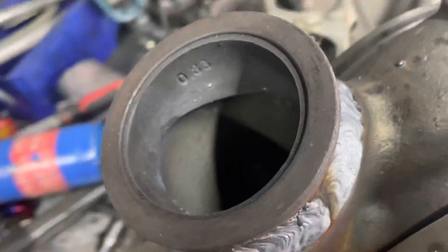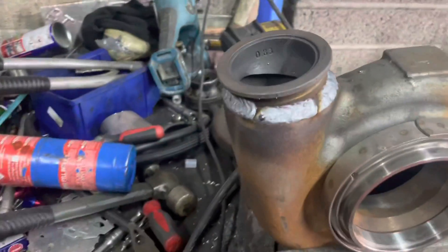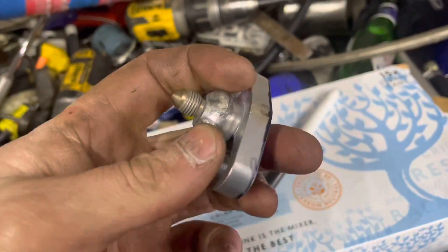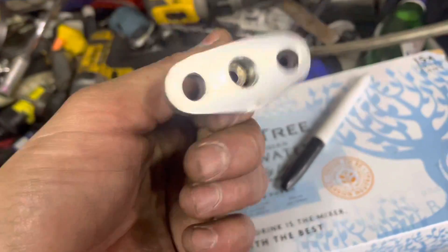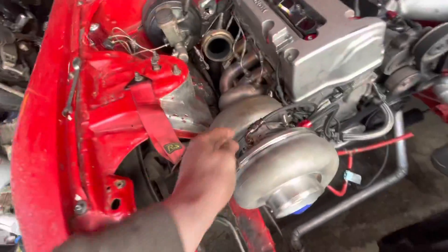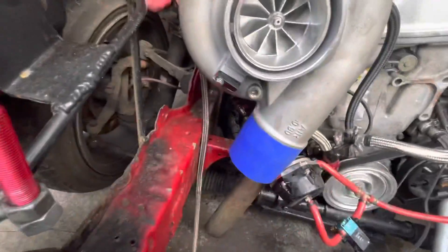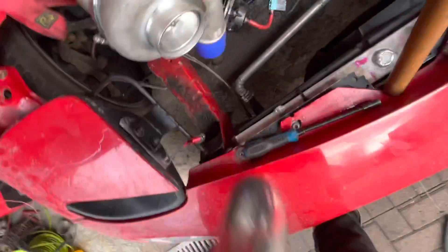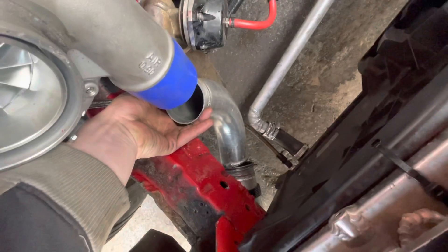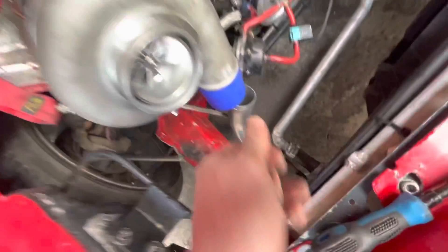As you can see, that's not actually that much left to do, to be honest with you. At least that'll fit anyway, so happy with that. I need to let it cool down gradually, but there's no way that's gonna fall off. Now it's welded on — it's like a little restrictor — and I made this piece up here. I just need to make a little gasket for it, I'll probably use a bit of thin card for that. One thing I did find though, is I'm gonna have this poking at the bonnet too, which is a bit of a pain in the arse. I'll aim this in the direction down here towards the pipe — I've got a 90 degree bend here that I'll use and come off there with ERC clamps. They're nice to fit. I'll fire it up in this direction and it should be good.